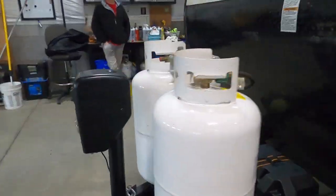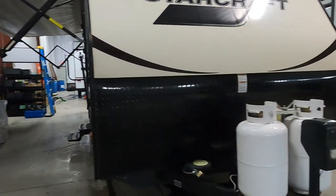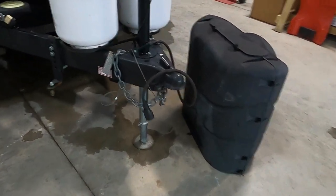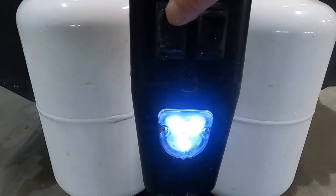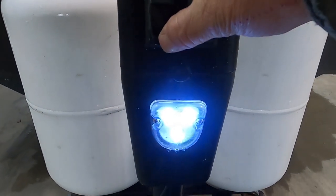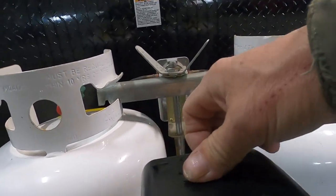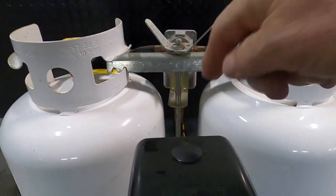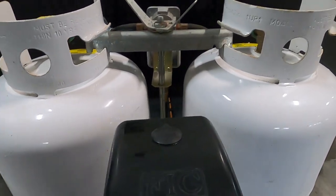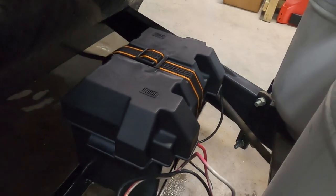On your campsite side, you're just going to want to leave room for that awning. Once we arrive and unhook our hitch, first thing we're going to do is level our unit. It comes with a power tongue jack, and a night docking light should you arrive at night. It should be raised or lowered until you're level. Underneath this rubber stopper, should you lose power, is a little button — a hand crank to get this up and down. Speaking of power, check your battery posts every now and then to make sure those haven't wiggled loose going down the road.